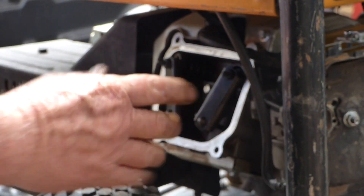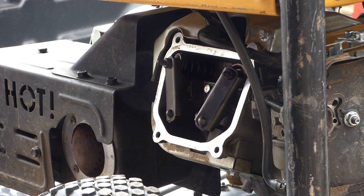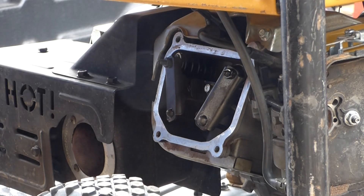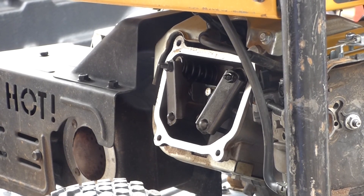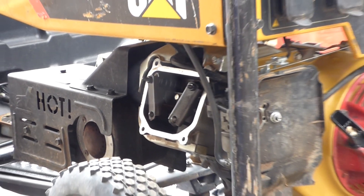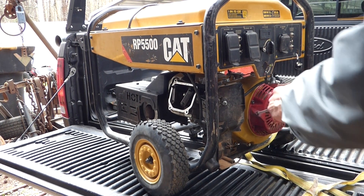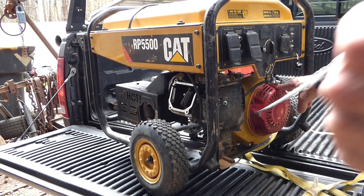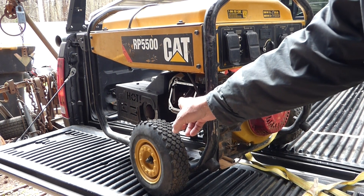Because you've got pressure, it's just not going to the right place. Neither one is stuck — they both have free play right there. Maybe the valve itself has a groove burned in it. If there's a bad valve, you have to pull the head off. If you run into this and you're looking at buying or fixing something, the first thing you want to do is check if you've got compression. No compression means a bad piston, broken rings, or a bad valve.